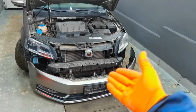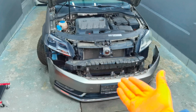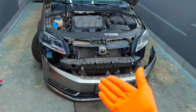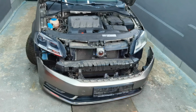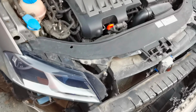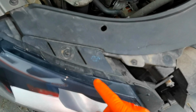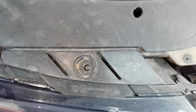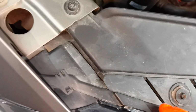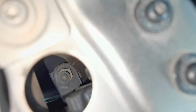In today's episode I'm going to show you how to remove the headlights from a Volkswagen Passat B7 from the year 2011 and up. In the previous video I showed you guys how to remove the front bumper on this car, and now in today's video I'm going to show you how to remove the headlights. To begin, you'll have to remove the front bumper. If you didn't watch my previous video, I recommend you check the link in the description and watch it before doing this, because you won't be able to remove the headlights if you don't remove the bumper first.